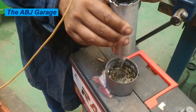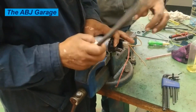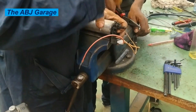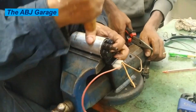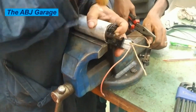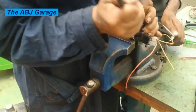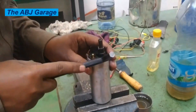Previously when we disassembled it we didn't do a very clean job — some fractures and irregularities are observed on the housing. Simple tapping will do the trick. Press the commutator and press the brush holder and the discharge side, then tap it a little. Tapping will ensure this is a fuel-tight seal, otherwise it will lead to pressure leakage from the discharge side of the fuel pump.